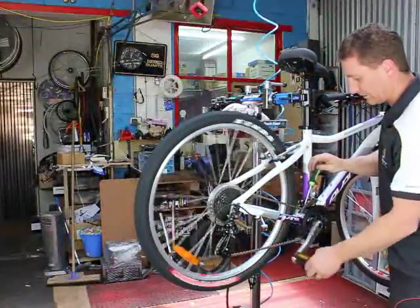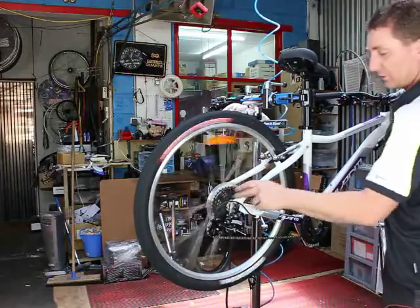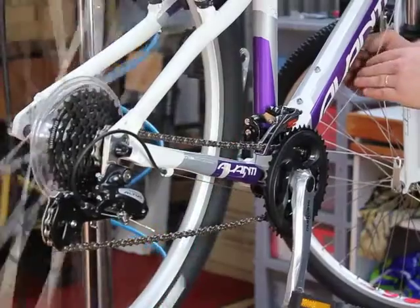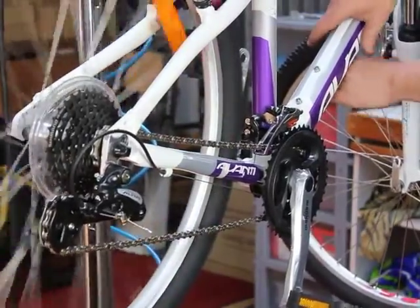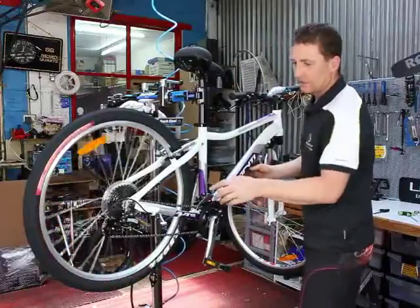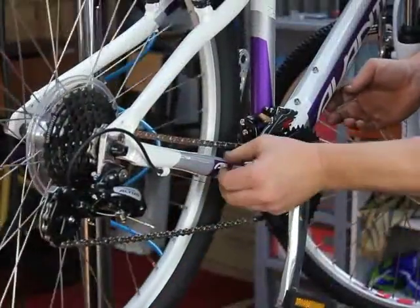That's looking good there - we've got our one millimetre of clearance down here. So now what we want to do is put the rear derailleur into the smallest cog, which is the highest gear. Pre-stretch the cables as much as you can - getting the down tube cables at the front of the bike in your hands, just apply pressure by hand quite firmly onto those cables. That will just finish swaging the end ferrules onto the outer cables and take up any play that's going to come in once that's all bound back up.